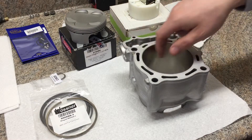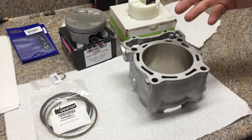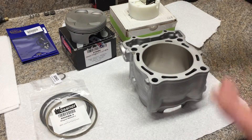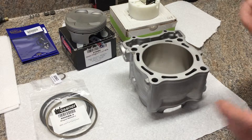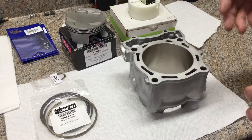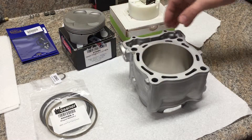It'll run fine. The other reason for keeping the bore small is that I kind of like the power band of the smaller bore. When you put a big bore kit on you typically shift the torque down lower — all else the same, with factory cam specs, factory valve size, you're basically just shifting your power down and it gets more bottom-end grunt. That's fine for some people depending on what kind of trail riding or racing they're doing. For me I like the characteristics of the stock bore size, and stock compression is a reliability thing.